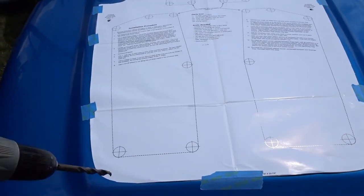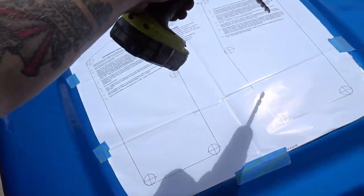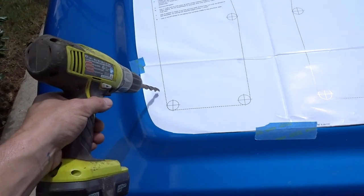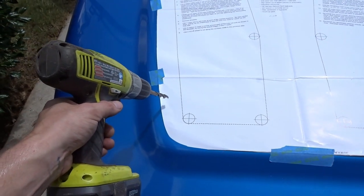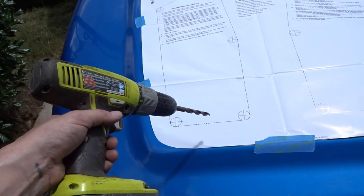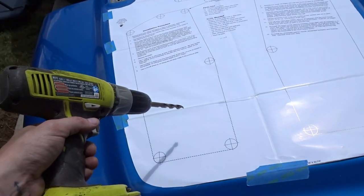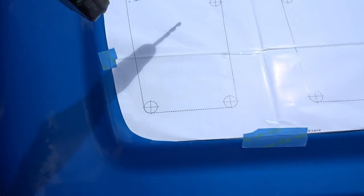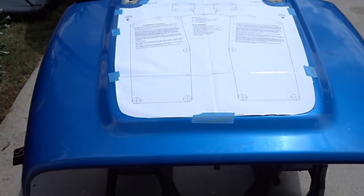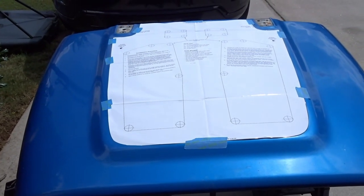The thing really is that as long as this is open, it's going to move air through the vents. What you just don't want to do is go beyond the edge of the template, otherwise you wouldn't have anything to screw into. You wouldn't have anything to fasten the plate with. So this could be a tiny hole and it would still move air out of the hood, right? So I'm just gonna drill some holes as a guide, and then I'm gonna trace.